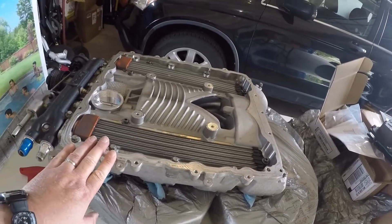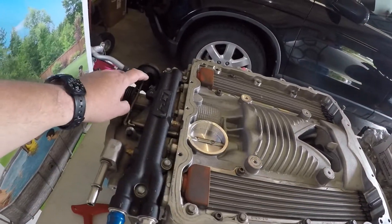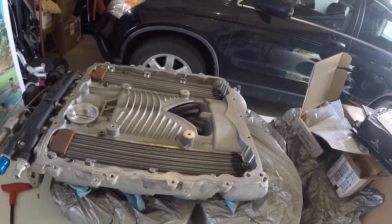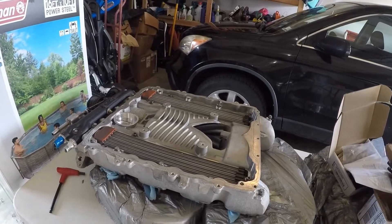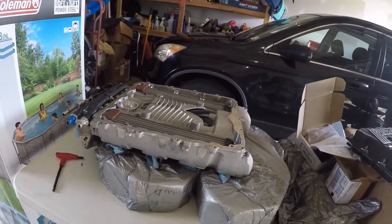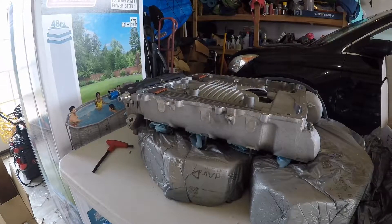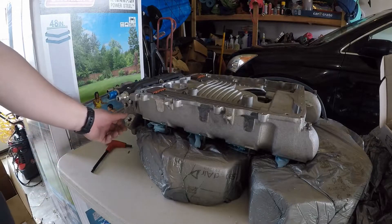Once I got it in, I wanted to do a visual inspection. There are some things on these superchargers that people complain about — one being the coupler inside the snout. When you pull off the snout there's a spring-loaded coupler in there that over time begins to rattle and makes noise at different RPMs. Some have wear marks in the shaft too. We'll look at that when we do the pulley change, but for this video I'm going off what GM recommends for a visual inspection before we get too far into the install process.